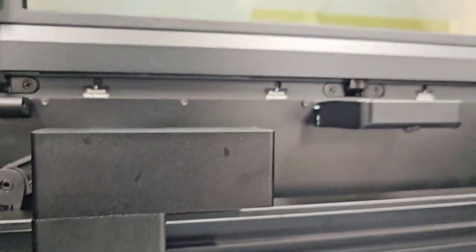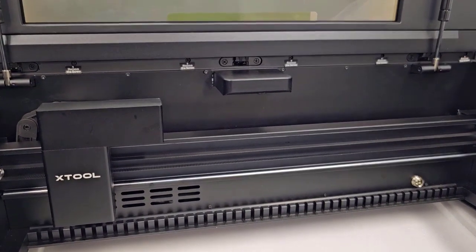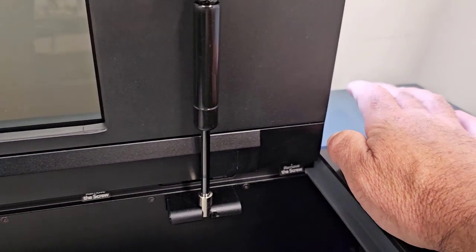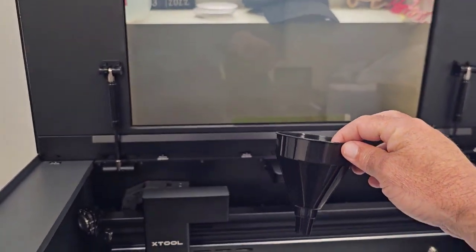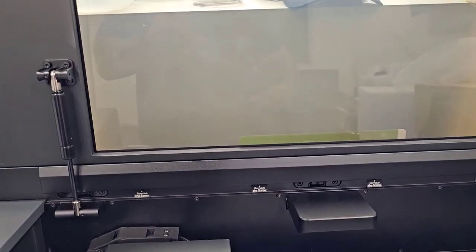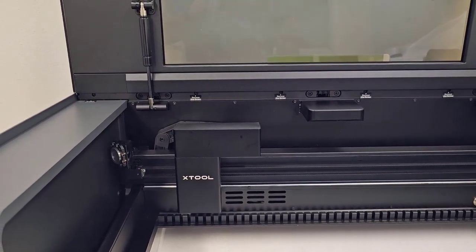The next step is that they ship it without the coolant in it, which is probably pretty clever — there's no way it's going to leak during shipping. So we're going to remove some screws here, then go around the back and remove some screws to take this back cover off. It comes with a funnel to fill it up. There's a calculation for how much coolant and how much water to use based on the minimum temperature in your area. I live near Palm Springs, so it rarely gets below zero degrees Celsius, so I use pure distilled water. Not deionized water, not purified water, not bottled water, not tap water — distilled water only.